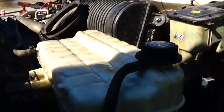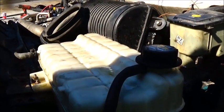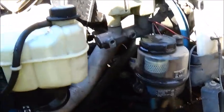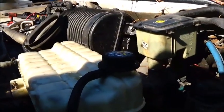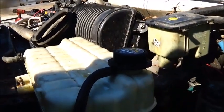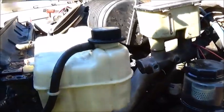It was supposed to have a blown head gasket, but I had no way of testing it with no radiator in it, so we're getting ready to try to start it. Been charging the batteries and jumping it off. Once we get it started we're gonna let it run a little bit. On these Duramax engines when they blow a head gasket, they usually just put pressure in the radiator. I don't have a pressure tester but I can tell if the hoses start getting too hard.